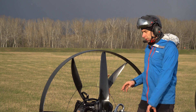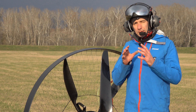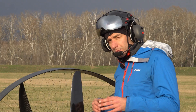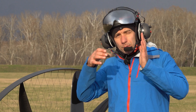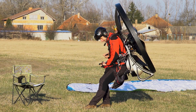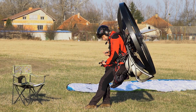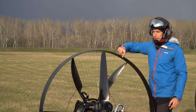What's happening is that the Vitorazzi Master and the Master Factory R has a pretty unfortunate positioning of the rubber mounts. The thrust line is actually centimeters above the top rubber mounts. So as the engine is pushing, the top rubber mounts get compressed but the bottom rubber mounts get stretched. Which means the whole engine kind of leans up and into — that means the top part of the prop gets further deeper into the cage, about two centimeters inside.